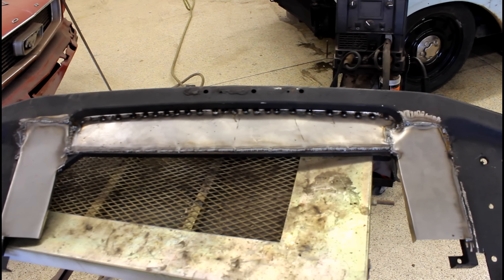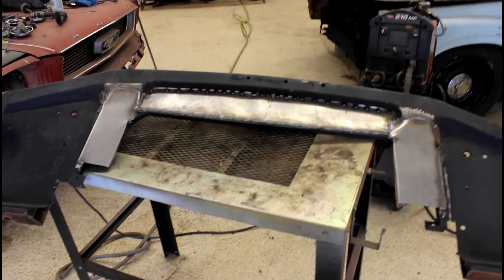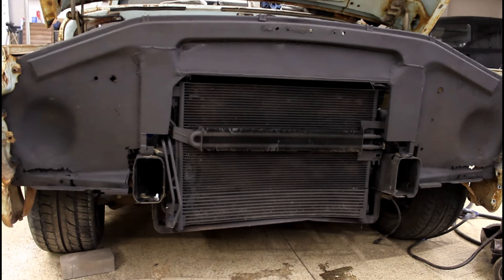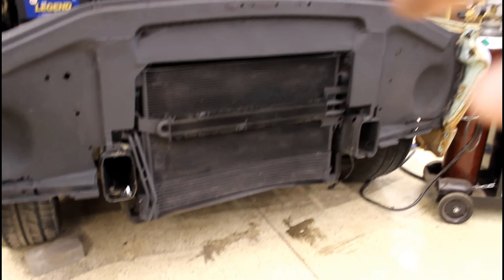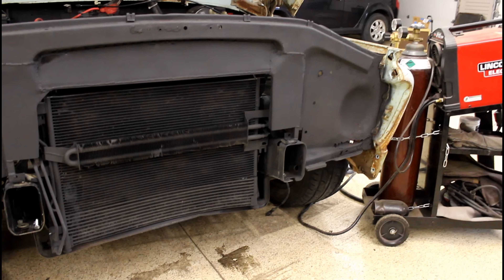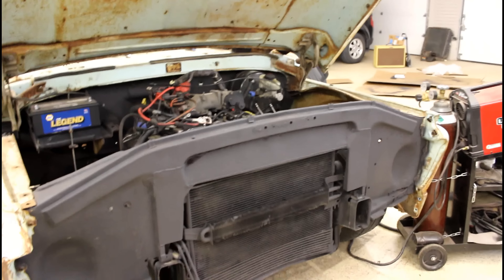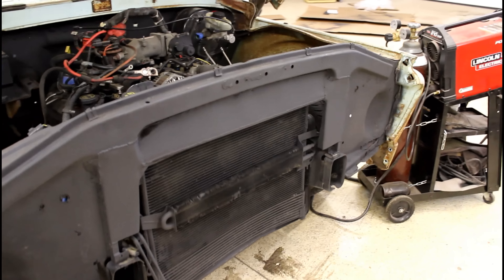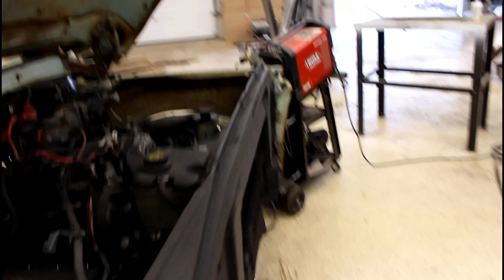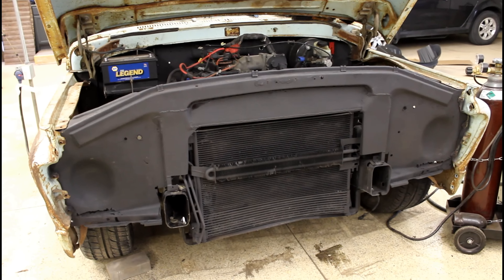The port is patched up, so now we'll have air going where I want it to go and keep the rain out. Get that thing painted up and mount it. It's on there and it looks good. I'll still probably do some rubber inserts here and on the other side and across the top just to keep rain out, because the ECU does sit under the hood there. Keep all the water out and the air going where I want it to go. Core support is done.